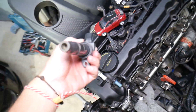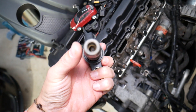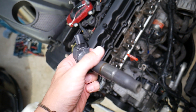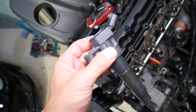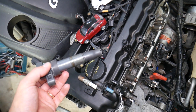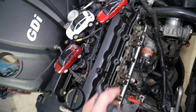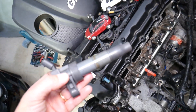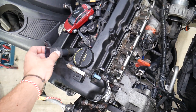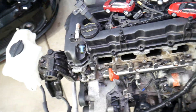Another thing: it could be a bad ignition coil, or an ignition coil not communicating with the spark plug. That could be caused by a broken element on the bottom of the ignition coil. If the electronics of the ignition coil go bad, most of the time it will cause a code such as P0351, 352, 353, or 354 respectively with the cylinder number — but at first it might just trigger a misfire code.